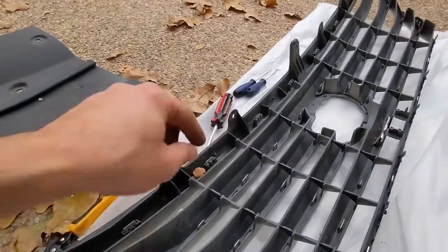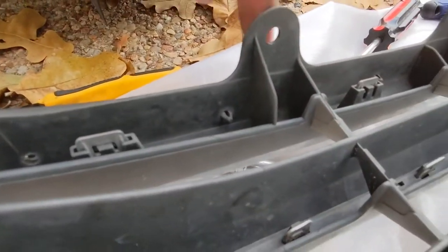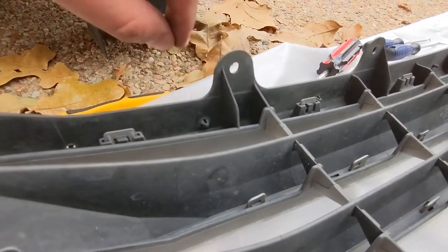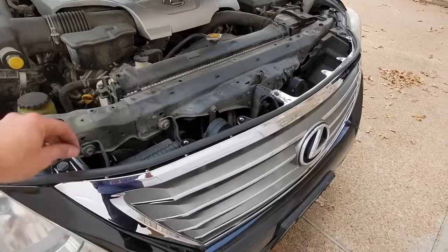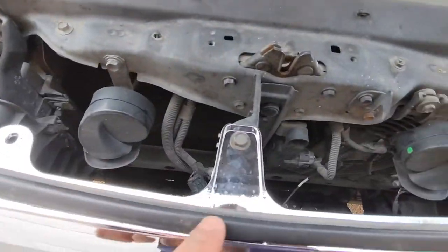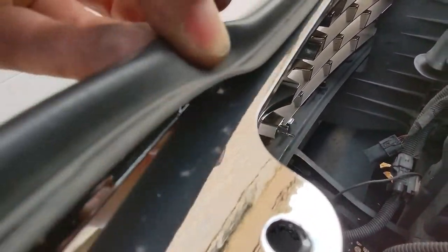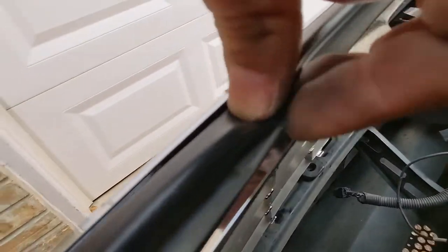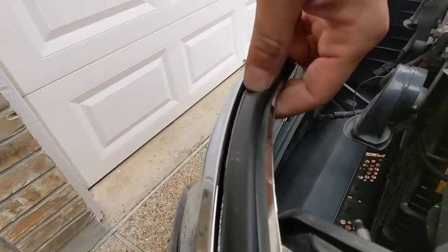Look at that — there's a rock in the old one! The weather stripping is held on by a bunch of clips that go into these holes right here. What I'm going to do is use needle nose pliers, squeeze each of these clips, push them out so they're reusable, and then place the weather stripping onto the new grille and push the clips back in. Here's the weather stripping. I've lined it up from edge to edge so that I'm sure it's in the right spot. I clipped in the center two clips first, then I'm going to go step by step, line up each clip with the hole, and clip it in.